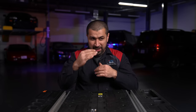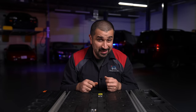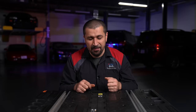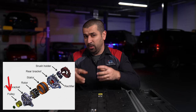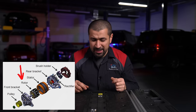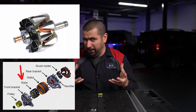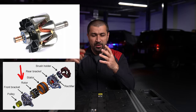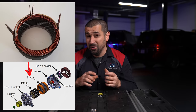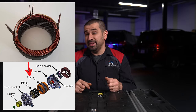If you create a magnetic field rotating on/off against coils, it's going to generate electricity. Your alternator is always being spun by the engine belt via a pulley, which spins the rotor — a small coil with metal plates that creates a magnet. When you spin this magnet against three phases of wire windings called the stator — the stationary outside component — you generate electricity.